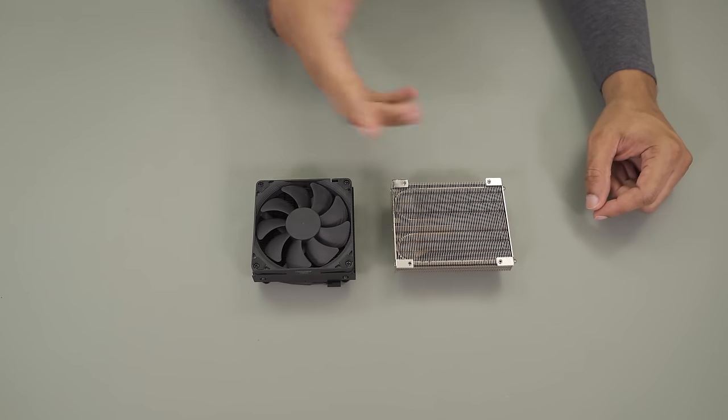The case does an adequate job of dealing with heat. The CPU is sitting at around 45 degrees C idle, which is definitely higher than you would normally expect, but keep in mind this is a 6-core, 12-thread CPU at 4.3 GHz in an ultra-compact system with one 92mm fan coming down on a tiny heatsink. So that's totally fine. When gaming, it was only touching the 65-70°C mark, never going above that, and totally under control in terms of temperatures while doing actual active tasks.